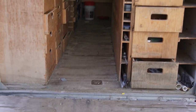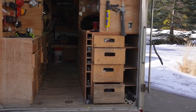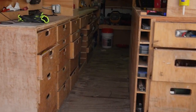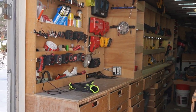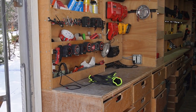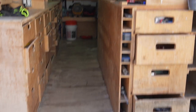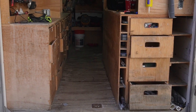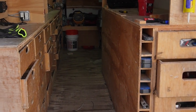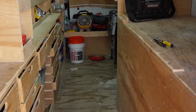I'll put a link in the description if you guys want full tours — I'm not doing a full tour of this thing. We've got the eight-foot drawers on the right. This is a Polk — basically modified Polk plans. Ron Polk, look him up, you can find the plans there. Fantastic, he does a great job with those plans. All aluminum, 7x16, 6'8" interior height, LEDs. We've got 330 watts of solar on the roof, a 690 amp-hour battery bank with a 3,000-watt inverter, and we do charge from shore power as well.